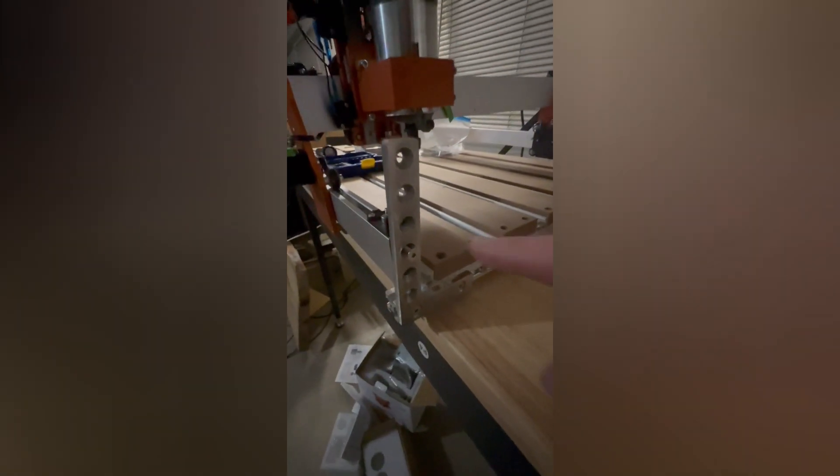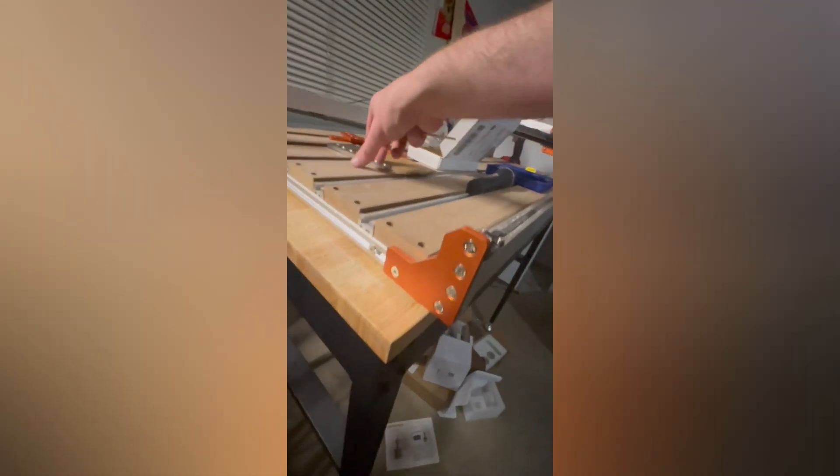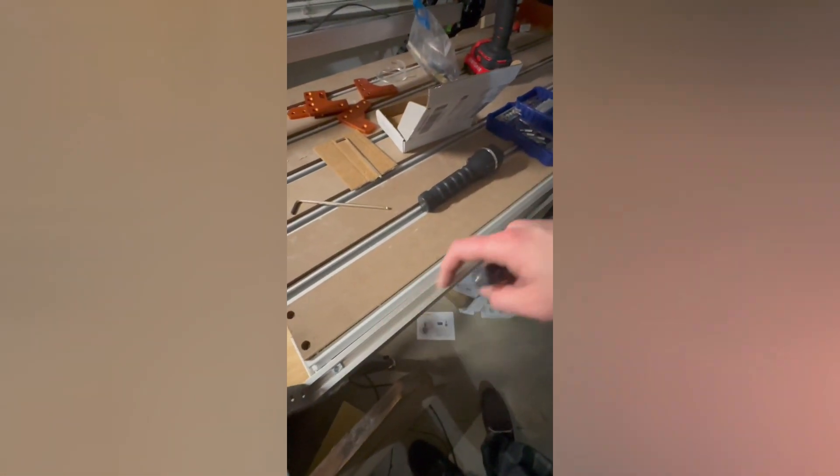Here's a small takeaway: I unscrewed the plate over here and lifted it up, screwed it into the first one, then came over here. When I put this one on, I'll go up to the next screw so it kind of inches its way up. One more small detail while I'm replacing this — I'm going to pull off the belt so I can vacuum in here and clean out any residue that could have built up.